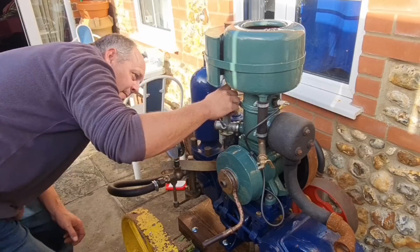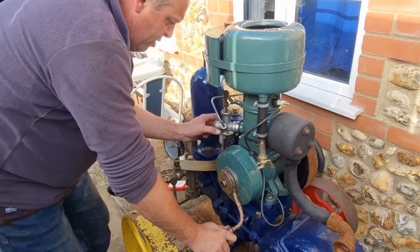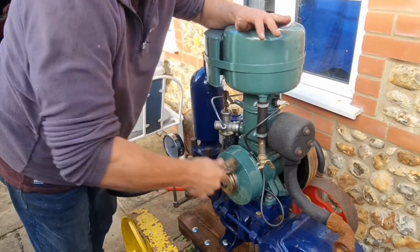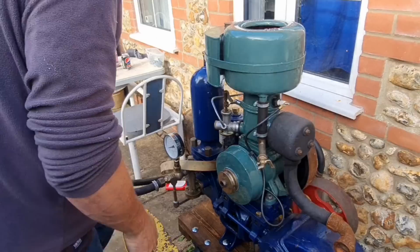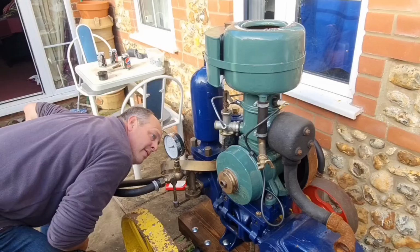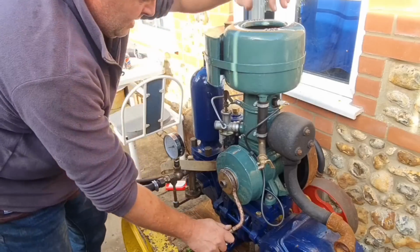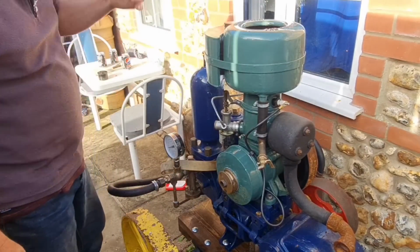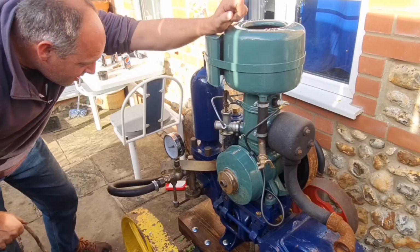Well, that plunger is going up and down. That should be flat out now. Idle now. Right, there are two mixture screws on here. Alright. I really don't know. I'm wondering if we should pop that carb off. It's definitely firing, I know that, so we've definitely got a spark because it is trying to go, but it seems it can't.